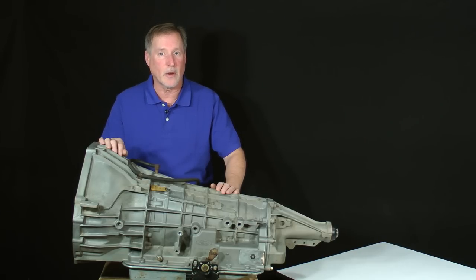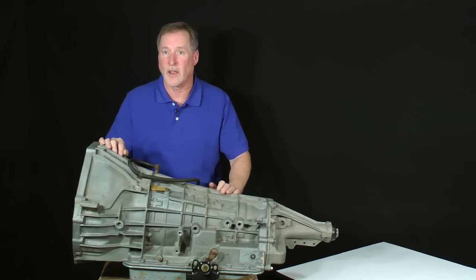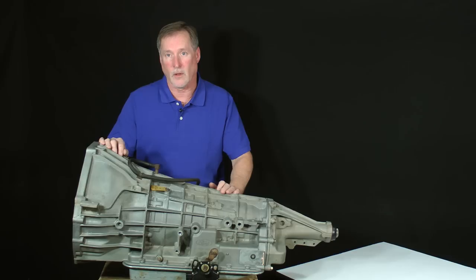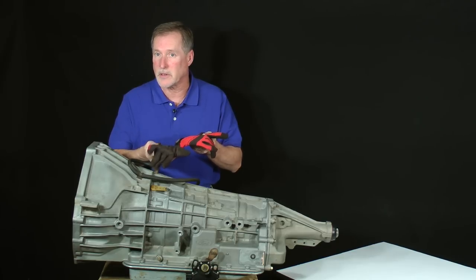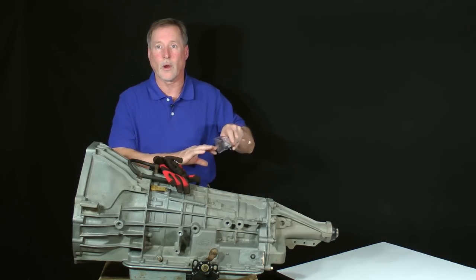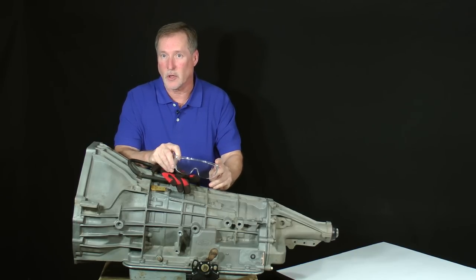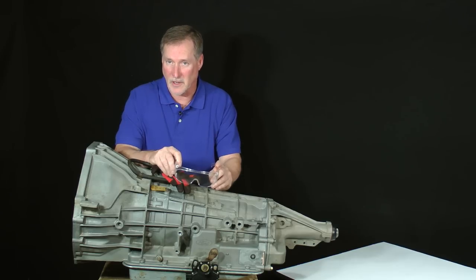One last point in this lesson — and the most important one of the entire project — work safely. Protect yourself from injury, as transmission repair can be hazardous. Make sure your work surface can support the weight of the E4OD 4R100; it's a heavy transmission. It also has razor-sharp edges in the valve body area and other sections of the case, so have suitable mechanics or thick leather gloves close by to protect your hands, fingers, and wrists from laceration. Remember to wear eye protection — starting with the next lesson, you will be required to wear safety glasses for the rest of this video classroom project. That's it for lesson one. Join me in lesson two and we'll begin the disassembly.